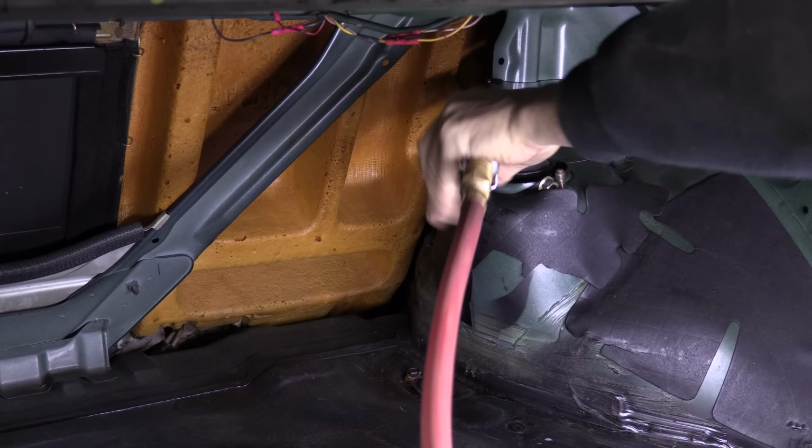It doesn't help you below 35 miles an hour. It doesn't do anything until you're rolling. It's for highway stability. It's also the system that led to the ultimate demise of this car's maintenance. I'm going to bank on this differential housing rusting out from power steering fluid leaks. It's not much different than brake fluid, so any rust protection will dissolve in it, exposing what's underneath.